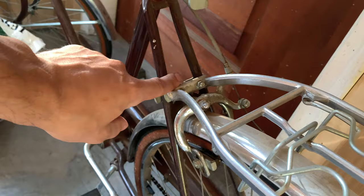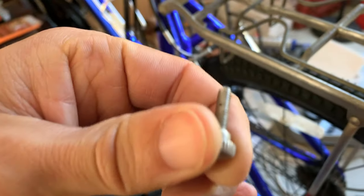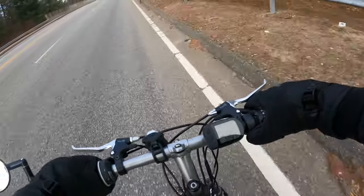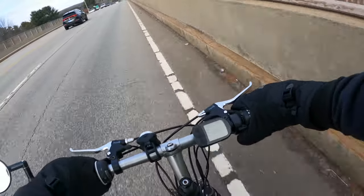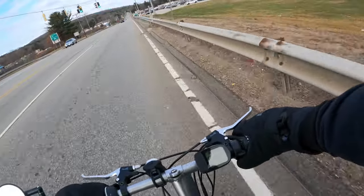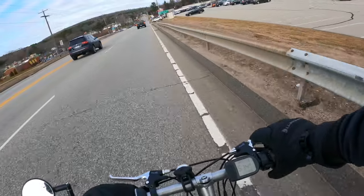The old-style bike rack can be mounted to all kinds of bikes, but I have to drill threaded holes in my frame to screw it in. The problem is the way it's made — it can fall apart. Bolts can fall out and the whole thing will fall backwards while you're riding. On the side of the road there's all the garbage, shrapnel, rocks, broken glass, sewer drains, more cracks — it sucks being on the side of the road. When you hit a bump with no rear suspension, everything's shaking and vibrating and screws will come loose. Anything you think is secure, you've got to double-secure it.